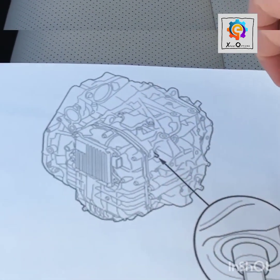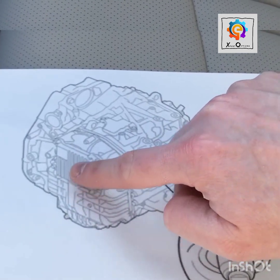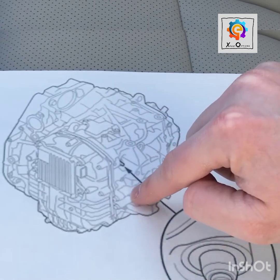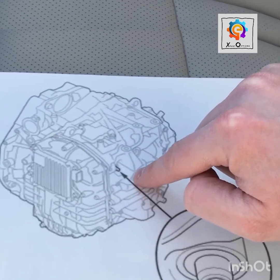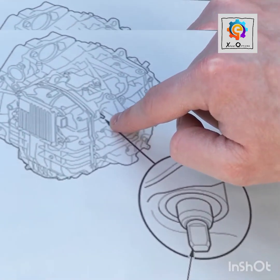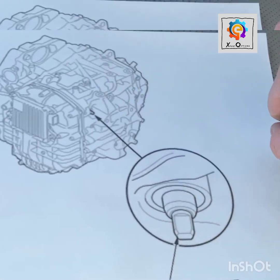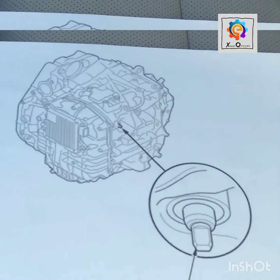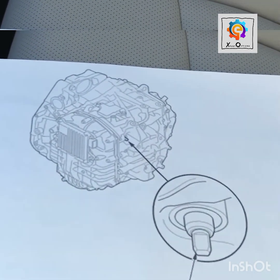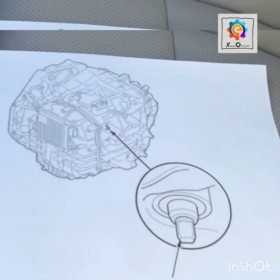Here is a picture of the 10-speed automatic transmission found in this Accord. The front of the transmission faces the front of the vehicle, and the back faces the rear. This side would be on the left side of the vehicle — or to your right if you're standing at the front of the car with the hood open. The control shaft right here — shown in an expanded view — is where you'd put a wrench to turn it and get the transmission into neutral. The air intake would be covering this section, so it's located under that.